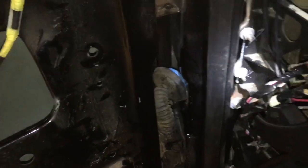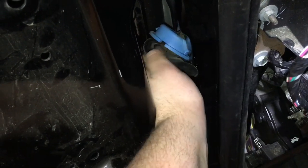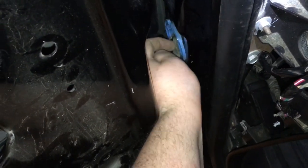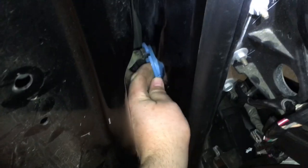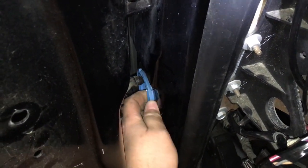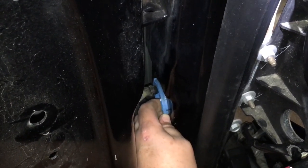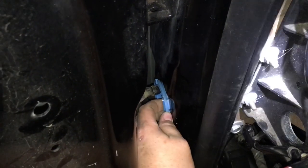Just a little edit to the video — these little clips are a pain to put back on in here. This thing gets pushed in like that. Pull it out so you can see that tab right there, then take a flat blade screwdriver, push on that tab, and just pull out towards the door and you should be able to pop that out.